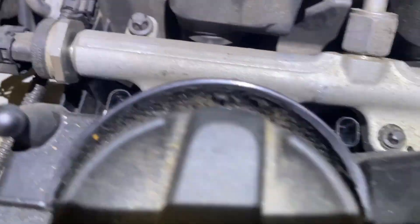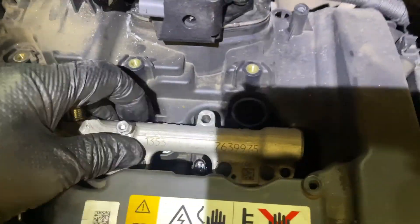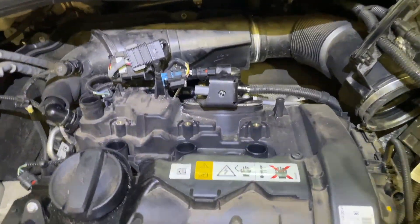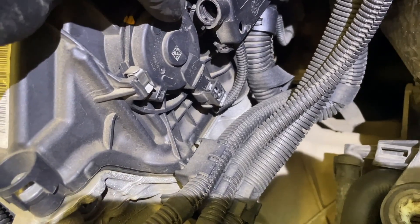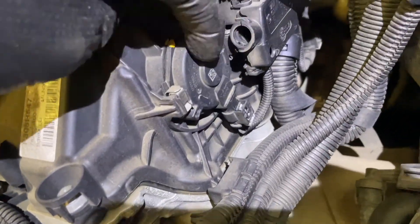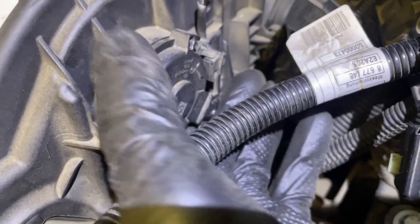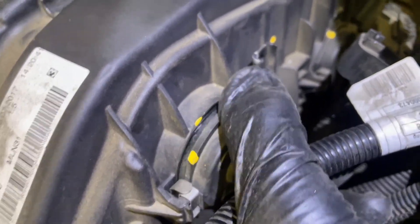You can see there's a connector there that'll come off. Only take out the larger of these screws. By applying gentle pressure, this whole injector rail with injectors comes out as one. You do not want to take those injectors off individually — it doesn't help. We're nearly in the position to get the rocker cover off. We've got to take off the fuel pump and we've got to disconnect these Vanos actuators. They are connected down there — disconnect them and then they come out by pushing on them. These need to come off before you take the rocker cover off, because you can damage things if you don't. By disconnecting the electrical connector and then twisting anti-clockwise, they should pop out. There is a rubber seal on this, so don't lose it — if you lose it, you'll have a terrible oil leak.